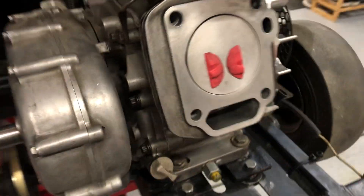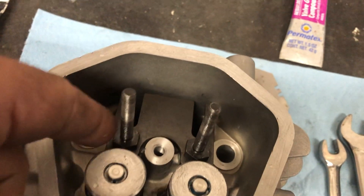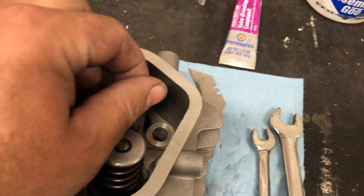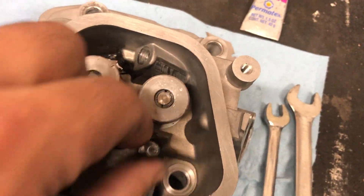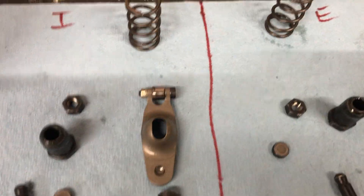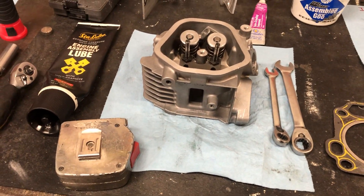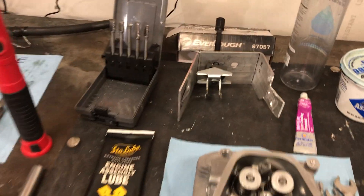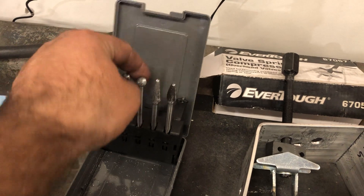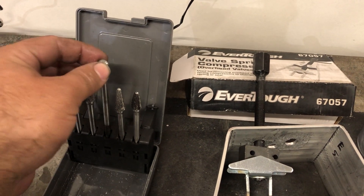I'm going to go ahead and finish putting it all together, but I wanted to share a couple more tips. I loctite these with a little blue loctite - clean the holes, clean the studs and threads really good, and snug them down, don't kill them. Unless you've got roller rockers with a shaft and roller bearings, these are billet with a roller tip, so it's better than stock. They're 1.2 ratio, from NR Racing. For the porting, this carbide burr set was really good for taking care of those transitional spots - it's a long-reach set so you can really get in there.